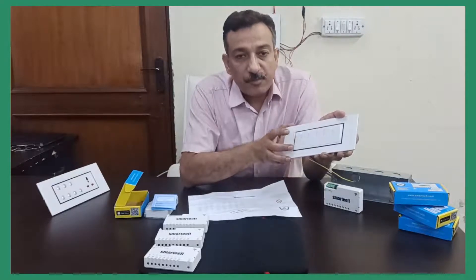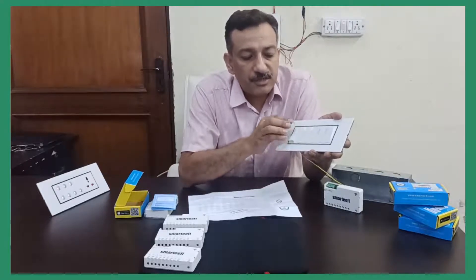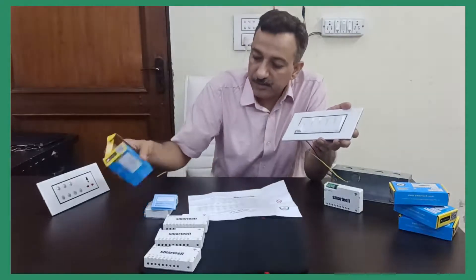In this model, you have to toggle the switch ON-OFF for a minimum of 5 times to take the device to setting mode — 1, 2, 3, 4, 5. The device will go to setting mode after that. To check whether the device is in setting mode or not, go to your mobile Wi-Fi settings. You will find a new 12-digit number which is the same as the serial number of the product. If you can see that 12-digit number, it means the device is in setting mode and you can proceed to Wi-Fi configuration.